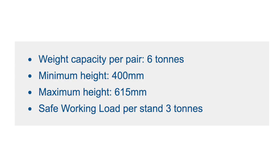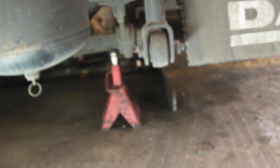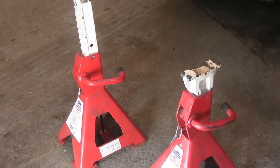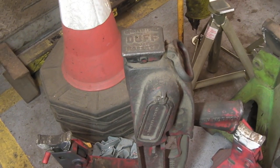Each one at a corner on a Land Rover is fine, there's not an issue. But just be aware that when you're buying six-ton axle stands as a set, they are actually only three tons each rated, and these are quite small. You can see one here on the corner of a DAF — the whole vehicle weighs nearly seven tons, but on this area it will weigh less than three tons. So sometimes we use these short little ones, which are competent. And if anybody recognises a farm jack, which is the old type of high-lift one, well, we're still using that one.